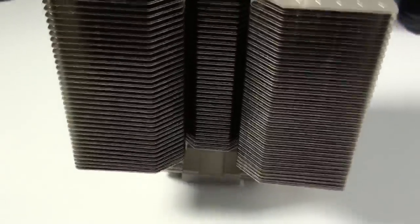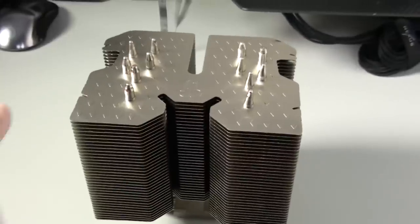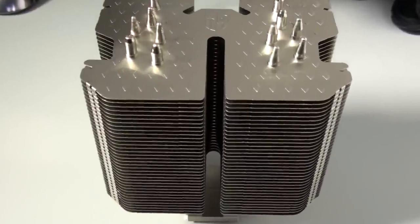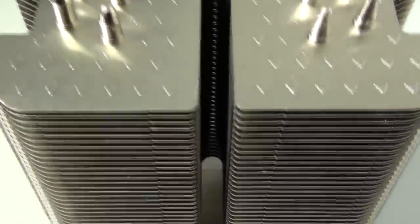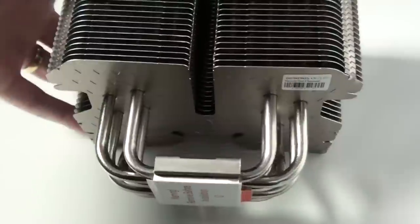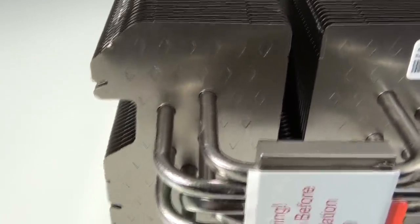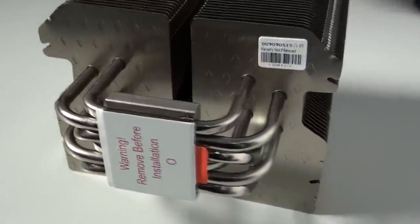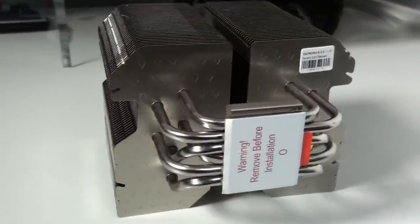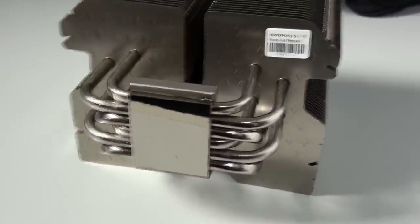For example, I think this cooler with a couple of 1,000 or even 800 RPM premium fans in push-pull would perform incredibly well. If you take a look at the amount of fin surface area that has been removed to achieve this particular shape, it is a substantial amount — had the fin surface area been maximized for this form factor, it could have meant a small difference in performance. Looking at the base of the cooler, you can see the two central heat pipes cross over, likely so they line up properly. The cold plate is fairly small, only just big enough for the heat pipes to pass through, and the heat pipes are about two to three millimeters from the bottom of the cold plate — the closer they are, the better the heat transfer into the pipes. The base of the cold plate has a nice mirror finish.